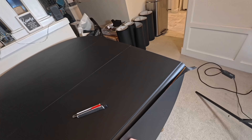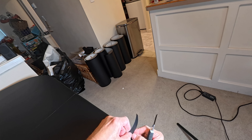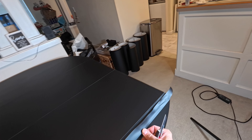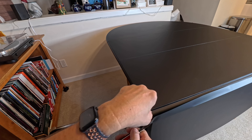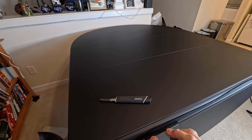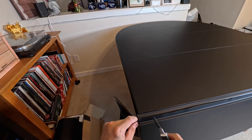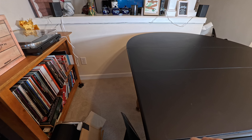That's where I bring it down, see the edge right there, and trim that off. I should have looked at the camera more - I'm focused and don't look at my phone. I take my thumb then the squeegee and push hard down on it so it's pushed in there. I'm going to use a little heat at the end to sink it in even more with the heat gun. I try to get about a half inch going underneath that I can actually cut, making it as perfect as possible.